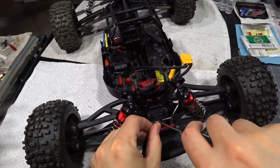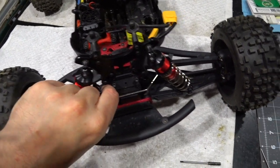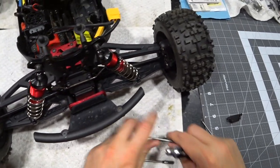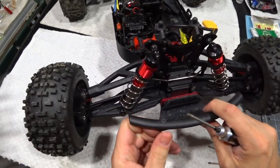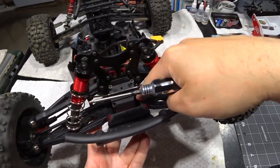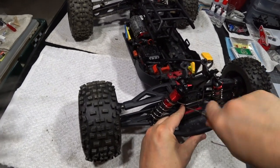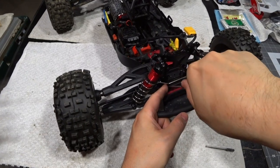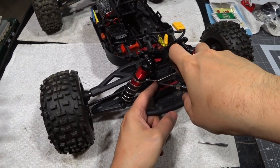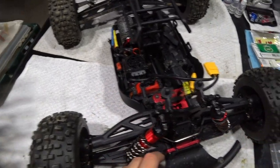That's just to get at this so that you can get your sway bar out of the way. So I need to get these bottom ones out. It's kind of dark in there, but there's two — screw there, screw there, top and bottom. In order to be able to slip the diff out around the axles, you do have to take the shocks off. So it's about a five to eight screw access. It's not super easy access, but easy enough.